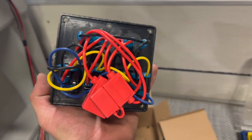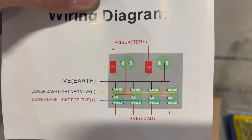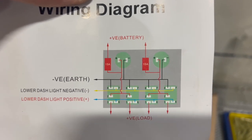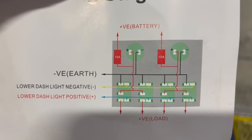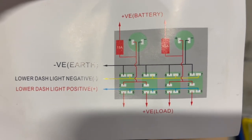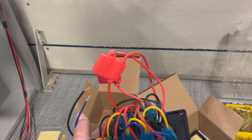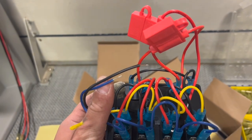It has a 12-volt and a USB plug. This is where people usually freak out — they look at the back side. This is how it comes in the box and they do give you a wiring diagram. We've got our power in, we have two 15-amp fuses in-line that are going to run power to the USB and power to your 12-volt charger, and then those jump to the switches. We also have a yellow wire that's actually a ground — that's a negative — that's going to be your lower dash light if you want those lights to stay on. That blue is to keep those lights on.